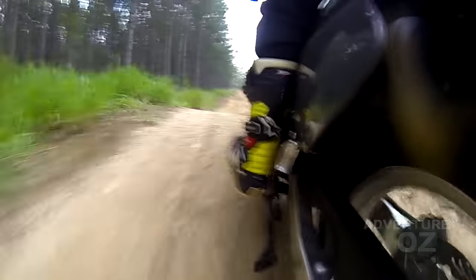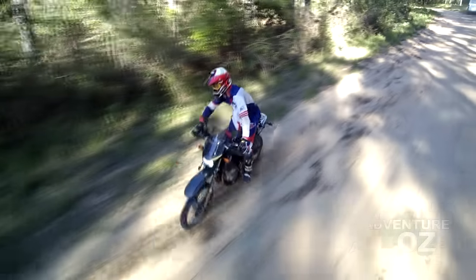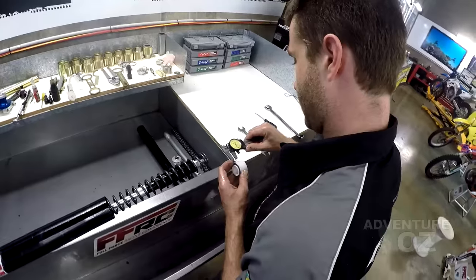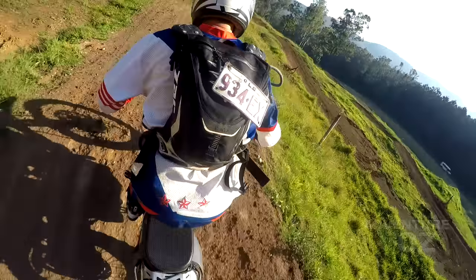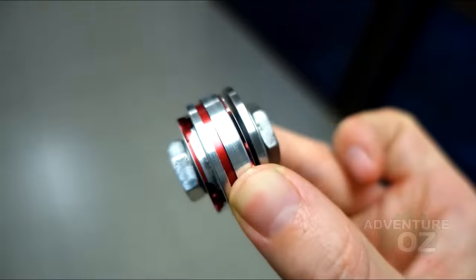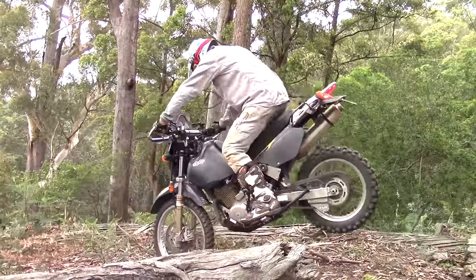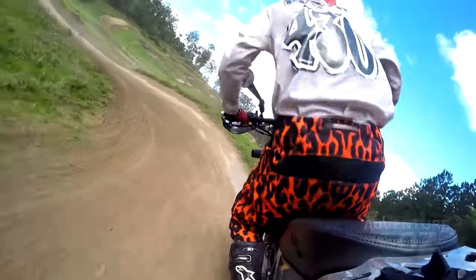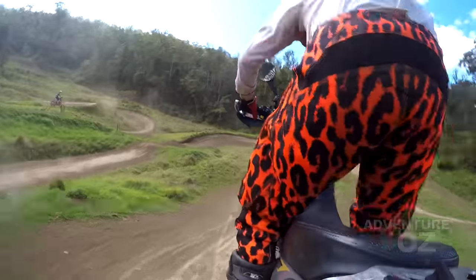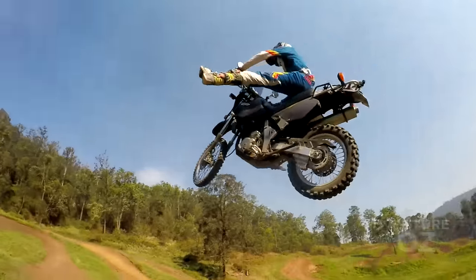But the second level improvements have been incredible. The rear shock was already dramatically improved with their custom valving, but now they've added a customised piston that makes the rear suspension even more plush over small bumps. And up front, they've invented their Plex valve, which works so well the stock forks are now the equivalent of good cartridge forks. The DR is now very plush over small bumps and corrugations, and yet also handles extreme abuse like this 60-foot jump with ease.